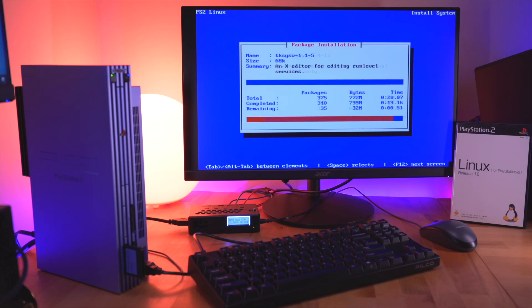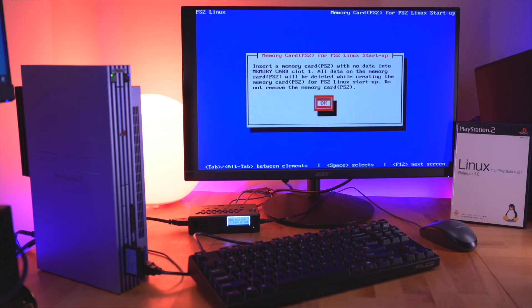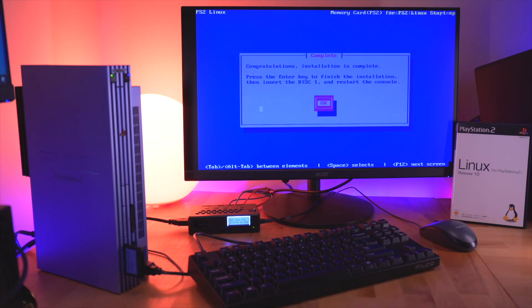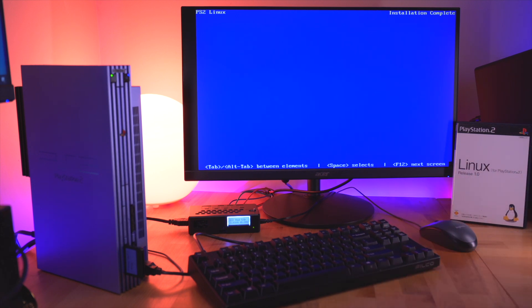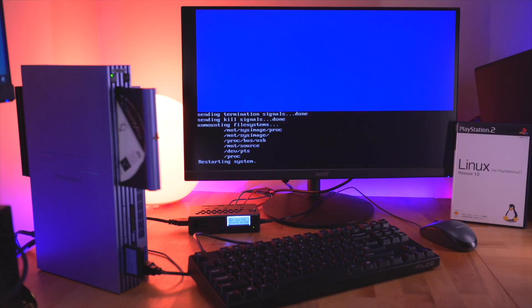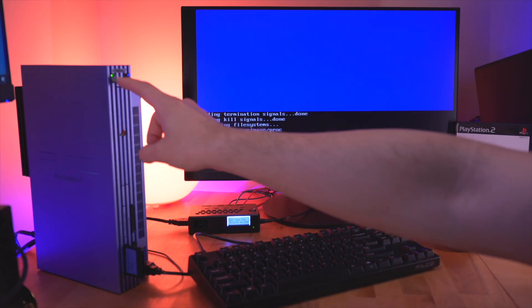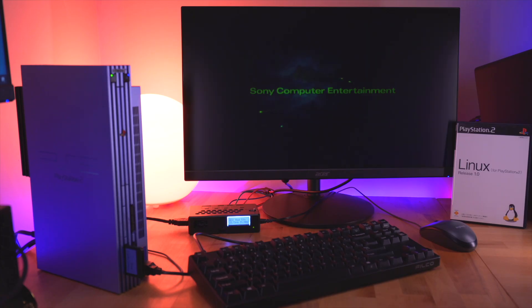This whole process can take up to around 25 to 30 minutes to complete, so I suggest getting up and stretching a little bit in the meantime. Once done, it asks you to insert your memory card — since mine is already installed, go ahead and press OK to continue. After about a minute, you get a window congratulating you on successfully installing Linux. It says to press Enter, then insert disk 1, and then reset the console. So press Enter, give it a couple minutes, and once you're on this screen, go ahead and insert disk 1, then press the reset button. Don't mind the green tint on screen — my OSSC is still set to sync on green, so everything will look fine once Linux is loaded.